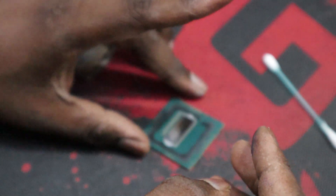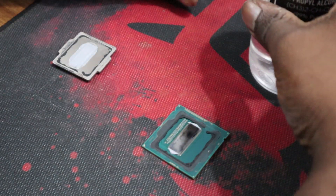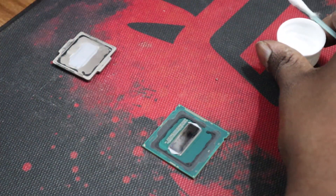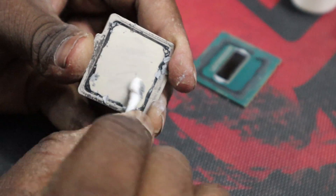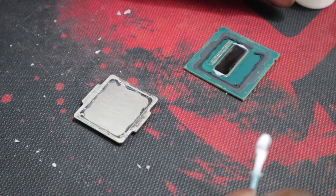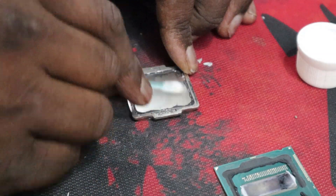Let's change the thermal paste. This is isopropyl alcohol, available on Amazon — link in the description below. Take some isopropyl alcohol in a cap and use cotton buds to clean the surfaces of the lid. Wait for the thermal paste to be fully removed so it doesn't interfere with the liquid metal. You'll find two layers: the solid thermal paste, and then the sealant used as a gasket between the processor and lid.